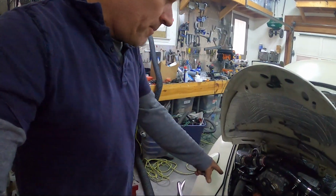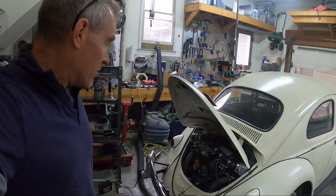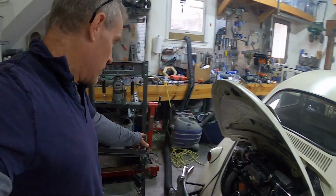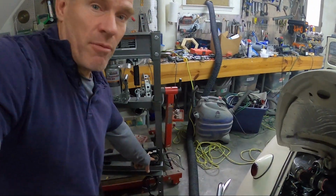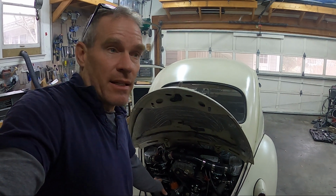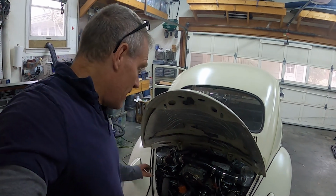So what I did is I checked it, and revving it up, it doesn't even get past like 20. It's like 18 or 20 or something like that. So it might even be that I can advance the timing just a tiny bit, and it might actually run better. I've been risk averse. This could probably be at 12.7 air-fuel, but it gets into the mid 11s, and that's just being safe. The timing could go to 24, but it's now at 18, 19, 20 when I'm revving it. So I think I'm just doing it safely, and I think it should be good at this point.